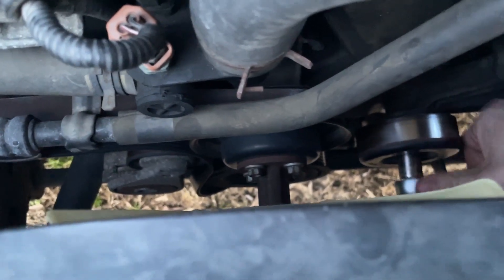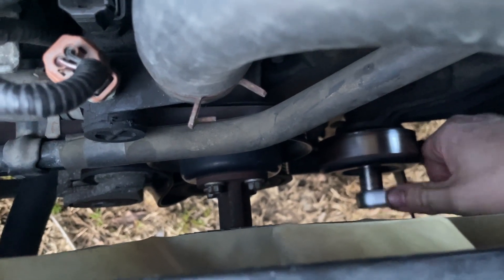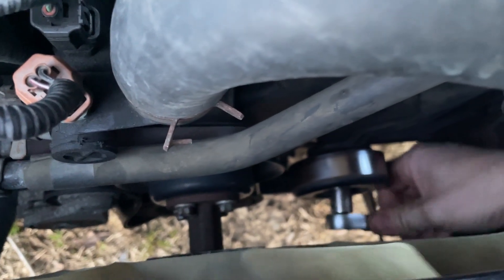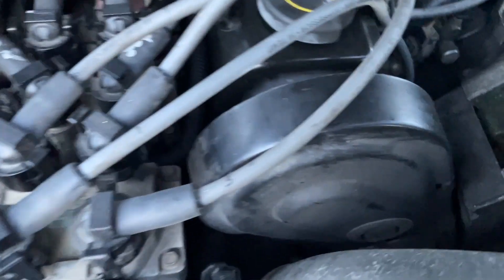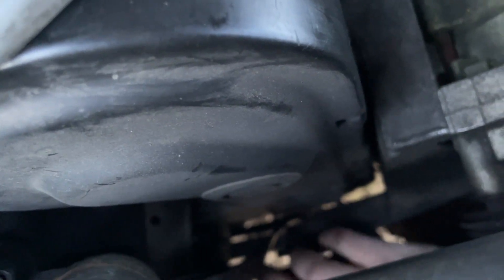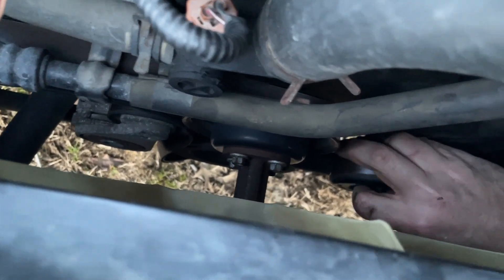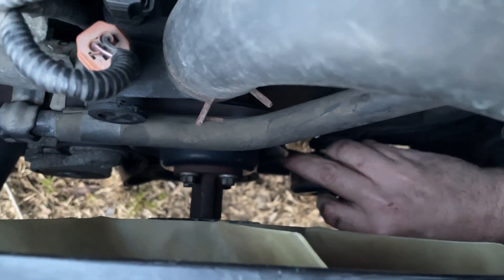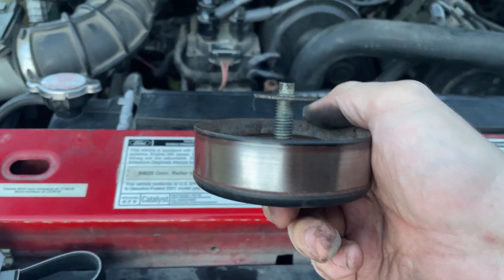You might have to pack a lunch - this thing takes a while to get out of there. If you've got an electric ratchet or impact ratchet, you might want to zip that on there. The back side is just about out, so we're going to turn it out by hand. We'll have our pulley off in just a second. This one's starting to squeal - makes a little chirping noise from time to time, so when it does that, it's time to change it. And there we have one pulley.